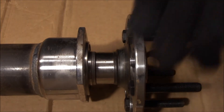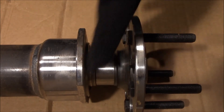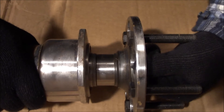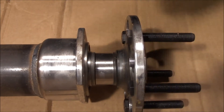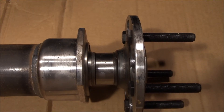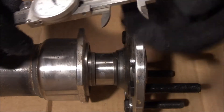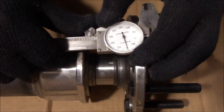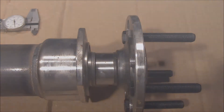This little lip that's left here for the bearing is where the bearing retainer catches the bearing — in this case the bearing retainer is going to be the caliper mounting bracket on the disc brakes, and it'll come down over here and catch this lip. Make sure the axle is pushed all the way in. It's also nice that this rear end has lightning holes in the axle flange — that gives us a place to stick the caliper through. Open the calipers up, wipe the surfaces off, and zero it.